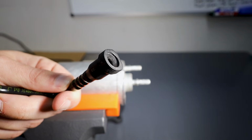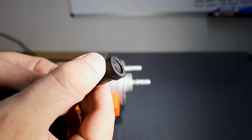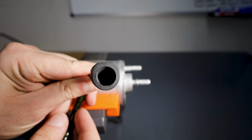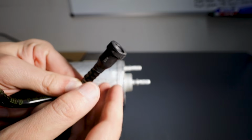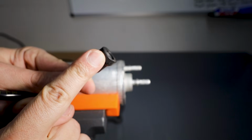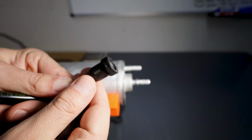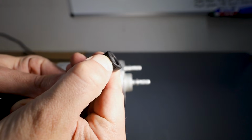It's actually the easier one to deal with, but it's sort of the most discreet way to release it because there's a little metal tab that's going to be on the rounded side of the fitting. So see how the top is a bit flat, bottom is round. On that bottom third or so, that's where you're going to have a little metal tab that you simply press in. You can do this usually with your hand, or you can use the flat side of a flat edge screwdriver to just depress it. And in true Audi fashion, it's usually a push in towards the connection, depress, pull out.